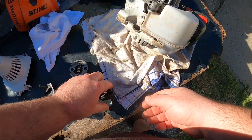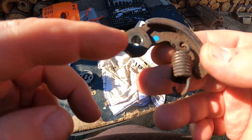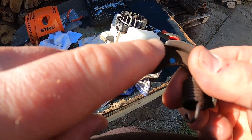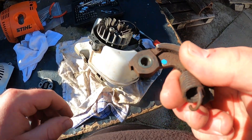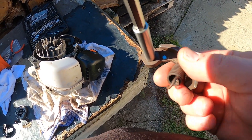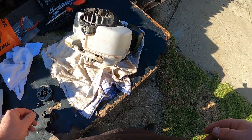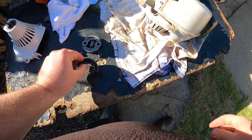The trick is, if you're going to work on this Stihl FS-130R, FS-110, or FS-90 with these sleeves in here, get a blowtorch and heat the clutch up on both sides so it's cherry red — as hot as possible. Then get a socket that fits over it to tap it through, something like a 10mm deep impact. That's how you remove those bushings when the clutch is frozen.